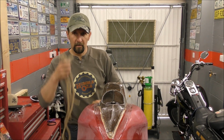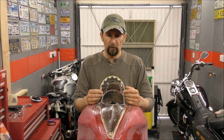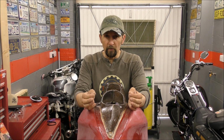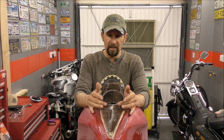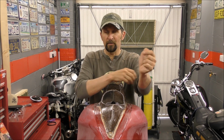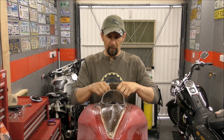Alright, rope. Now, I just flashed it over with some 40 grit paper just to knock off the sharp edges. If you've ever done this, you'll know that the resin, any little fluffy residue of fiberglass matting, or in this case cotton sheet, will form razor sharp little needles when it sets. So I've just knocked all those sharp edges off, made it a little bit more smooth and manageable, and at the same time let's keep it up a little bit ready to go.